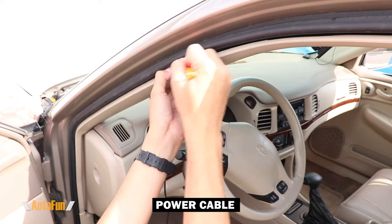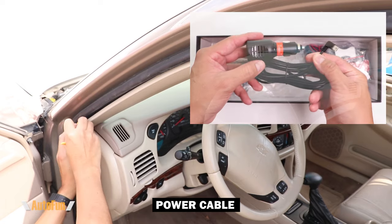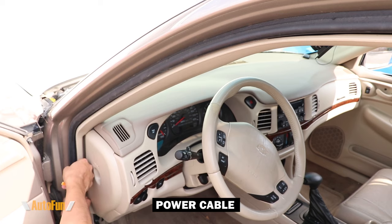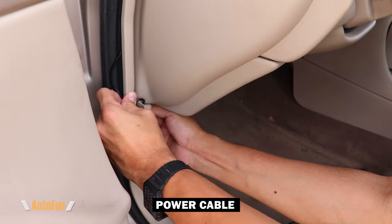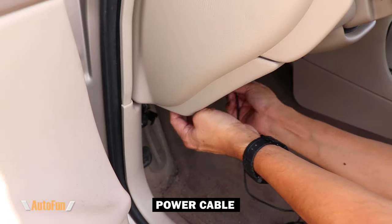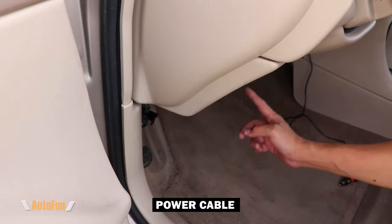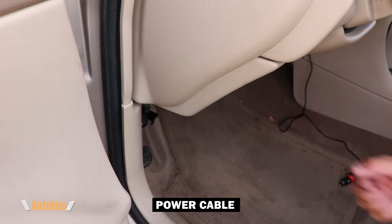The power cable has to feed all the way up into the cigarette lighter port of the vehicle. I'm going to feed the cable down towards the footrest area and hide it into the trim so it's not going to get pinched when the door closes or opens. Once I get closer towards the bottom of the vehicle, I'll hide it underneath the dash. I also secure it with some zip ties to ensure this cable never falls and gets in the way of the accelerator or brake pedal — this area must be kept clear for safety.